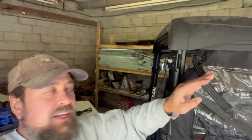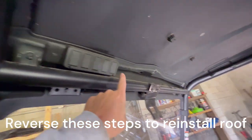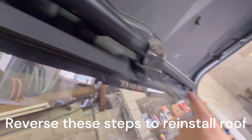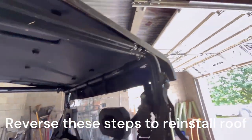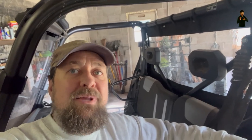Okay, due to frustration with these corners — I can't get these corners to do anything, I can't figure out how to get them in there — so what I did is I took these two bolts with the roof out. Now to get your roof off your CFMoto — this is the U4 600 model — let me show you the inside bolts you need to get out too. There was one that goes in the middle, then one on the other side, then one up here and on the same side over there. Once you have those off, this front part will pick up and you just slide it back and you can lift your roof off. After taking this off, I can tell you it's much easier if you just take the roof off from the beginning — putting this on is probably going to be about five minutes. Let me show you how it looks now that we took the roof off and I can adjust the straps easily.